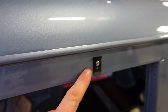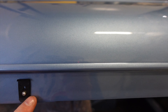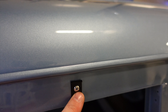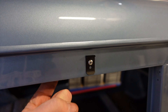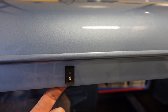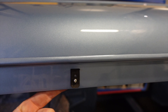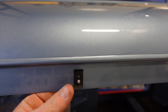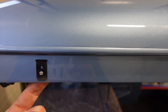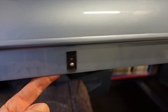Okay, so that's my top brackets riveted in place. When you do this, you really have to pay attention to which side you're riveting from, because this very first one you can actually rivet from the front, because it doesn't interfere with the window channel underneath. But once you get to the second one, you need to reverse that and rivet from the other side, so you've got the smallest part of the rivet on the inside of the car so it doesn't interfere with the window channel. And as you go down each of these, the rest of them are done from inside the car as well, just to make sure that you don't get interference.